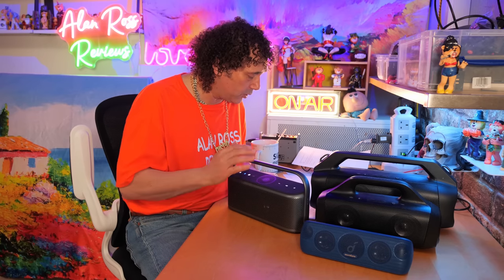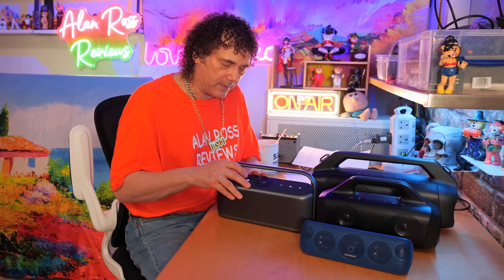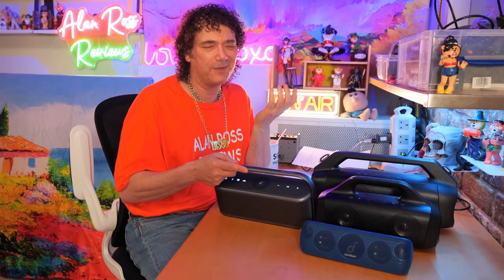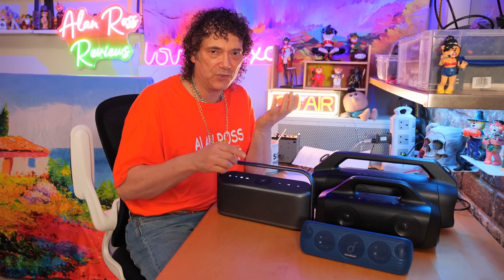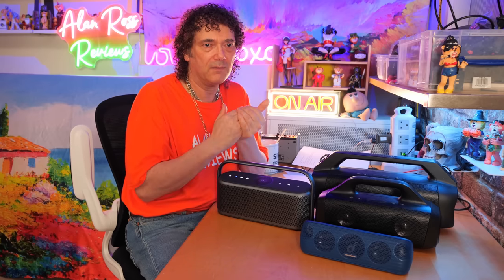It does sound open and airy. But the question is, so here's the thing. When I hit the bass up button, it's overdriven. You can hear it. It sounds like it's driving the passive radiator, so it's trying to boost the area of where the passive radiator is, and the woofer is already well dropped off, and it's a really low quality sound.